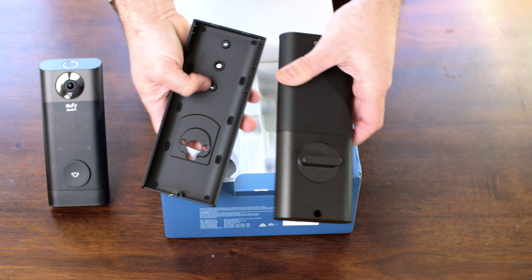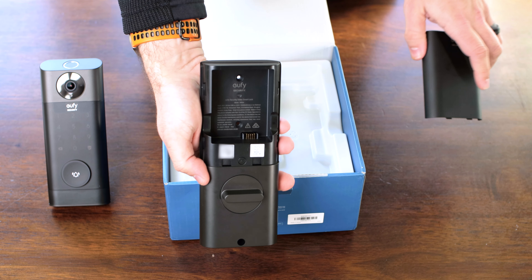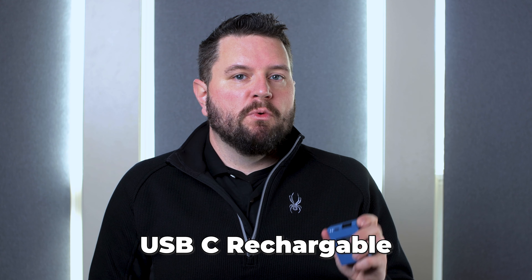The indoor unit comes in two pieces: a plate that attaches directly to the door, and the housing that contains the electronics. On the inside unit, there's a large battery door. The system comes with a 10,000 milliamp hour battery, smartly positioned on the inside of the door to avoid the detrimental effects of cold weather on the lithium battery. This battery is rechargeable with USB-C — just remove the battery cover, take the battery out, plug it in, and charge for a few hours. The unit will last about 120 days on a full charge using all features.